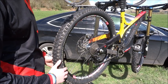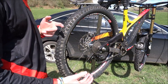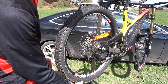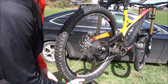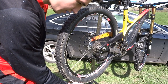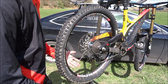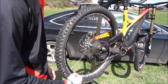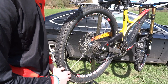I'm currently running a tubeless setup, which means there's a liquid sealant inside the tire. If you get a thorn that goes through the tire wall, the sealant will seal the hole and stop any air escaping. This is only possible with specific tubeless-ready rims and you need a compatible tire setup as well. I'm running a Schwalbe Magic Mary tire — it's 2.35 inches wide, holds loads of grip, and is good for all weather, wet or dry. You can set your tire PSI depending on track conditions: if it's really muddy and slippy you can go as low as 18 PSI, and if the track is drier and faster you can go up to around 25 PSI.